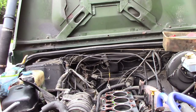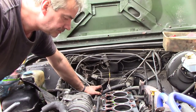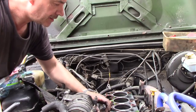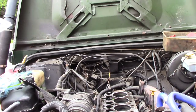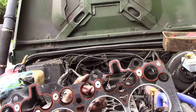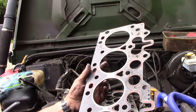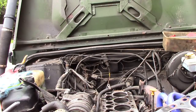I'm glad they're not cast iron. I can see they've put the old type of head gasket on, but there are no cuts or cracks in it. The newer type of gasket is a laminate gasket, but this looks perfect on both sides. I didn't fake this video — I genuinely don't know what's wrong with it.